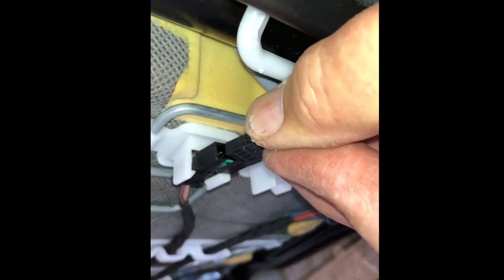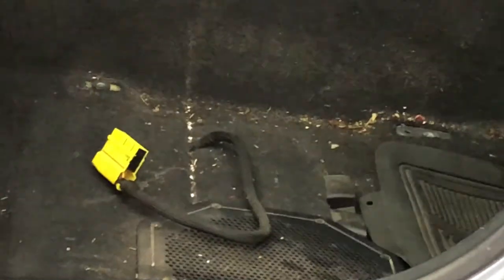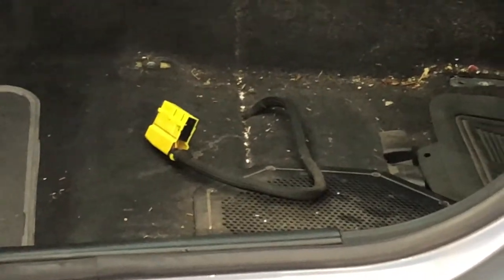Underneath the seat where your new cord came through — the seat sensor — plug that in. And the one under the cover: before you clip that on, put the seat bolster adjustment on, and if you've got electric here then you would have had to connect another wire back there. We're done — this is ready to go back in. Just vacuum up all the McDonald's chips and everything else that's fallen down beside the seat. Undo that yellow clip and bolt the seat back in.